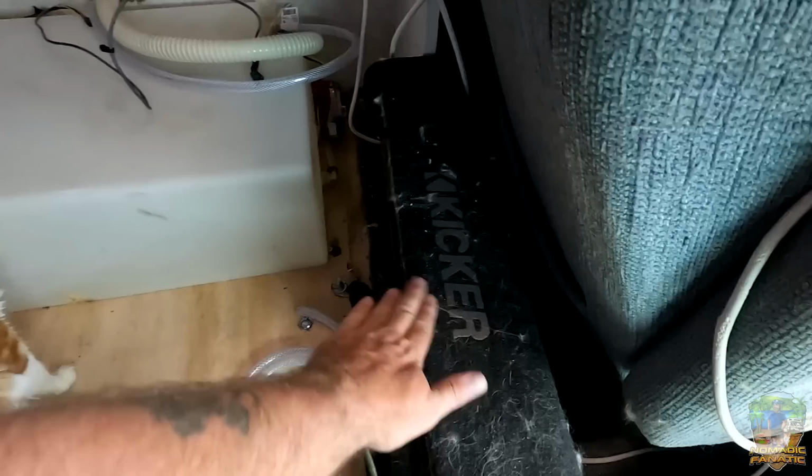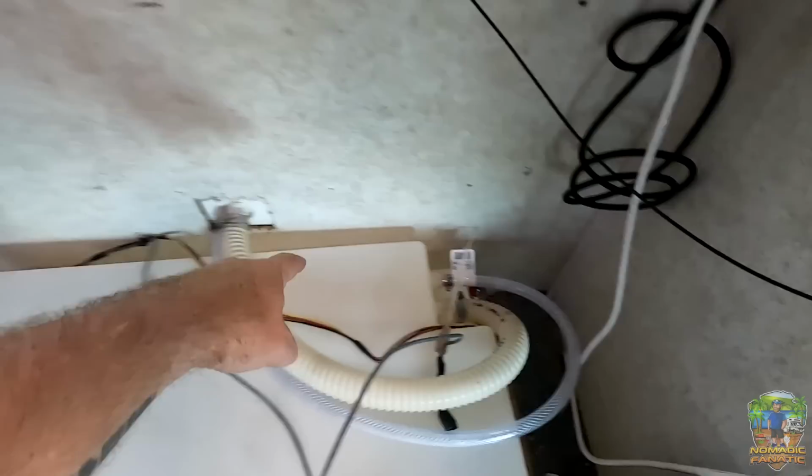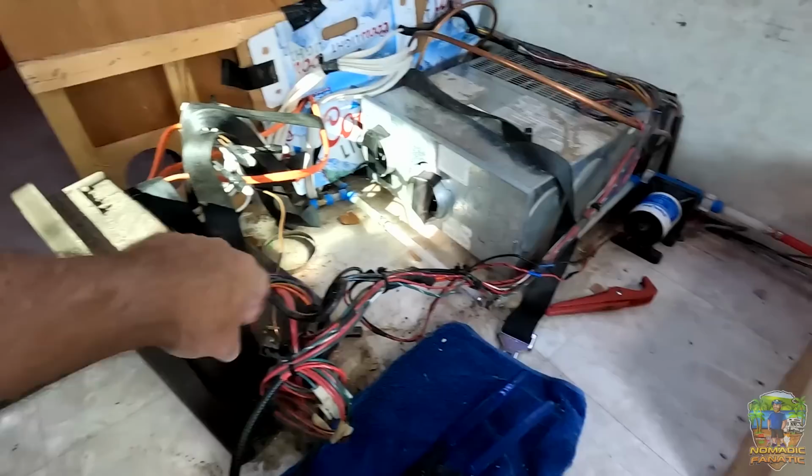Robert put in a new fill hose here from the outer. Also a new vent hose, half inch there. Also new PEX lines crimped that go across. The water pump has been moved to this location. It was right here. So water pump there, going there to the winterization stuff. Last step, Robert's gonna be doing some wiring to move the entire fuse box to sit right here in front of the water pump. I will admit, this is a lot tougher than I thought it was gonna be.